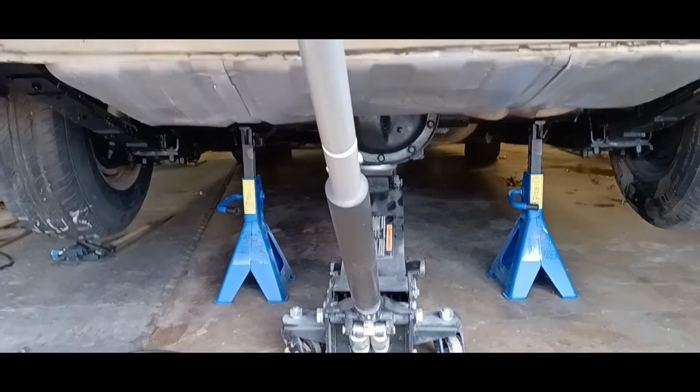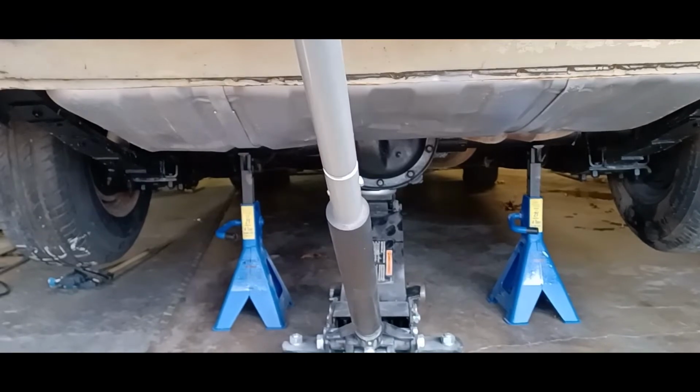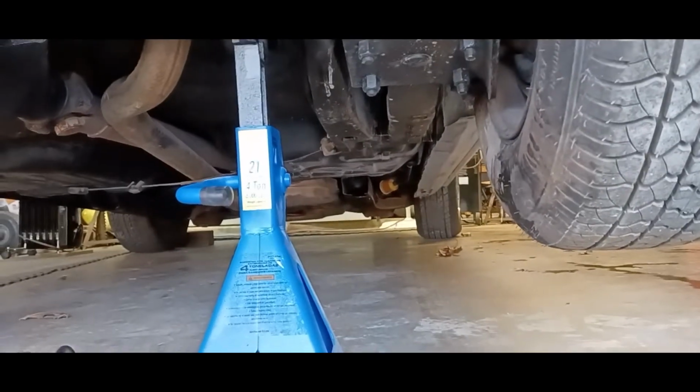We are going to be pulling out this gas tank on the 79 and installing a brand spanking new gas tank. I believe my gas tank is full of rust from sitting for 16 years, although it looks pretty good on the outside. I keep getting carburetor flooding issues where trash is getting past the fuel filter. You can actually see the fuel filter back there. I got one in line there and one at the carburetor itself.